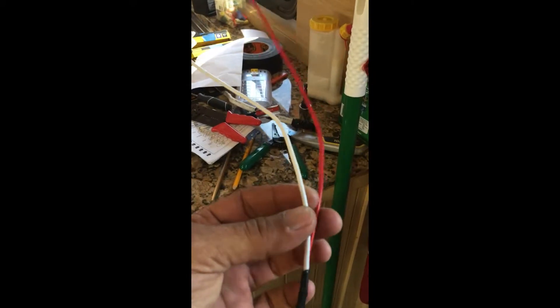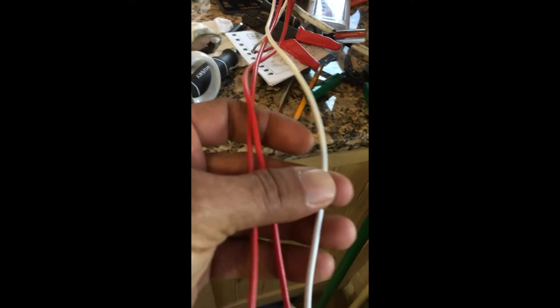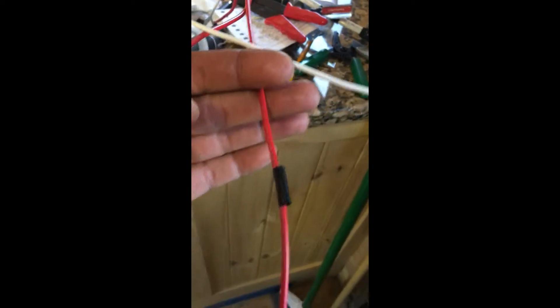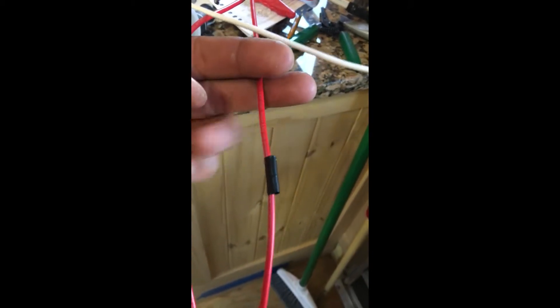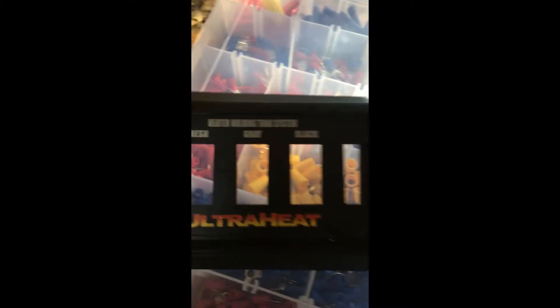What I've got left from what I ran earlier is a hot and a negative coming from the utility room, because that's where my heat pads are for my fresh water tank connections. This bundle of three — two reds (two hots) and a negative (white) — has a piece of black tape on it, which corresponds to the black tape at the bottom of the trailer, meaning my black water tank heater. All of these are going to go into my tank heater switch plate.